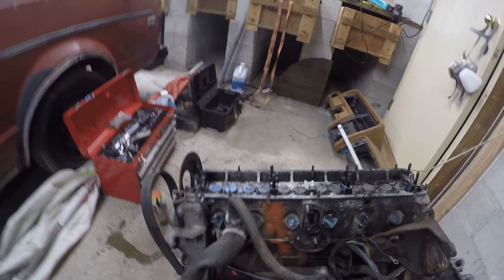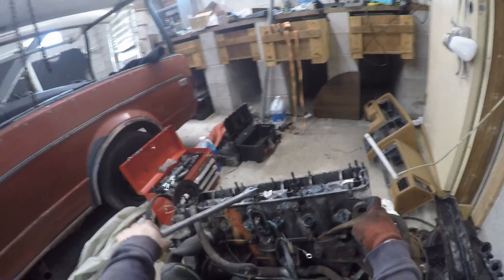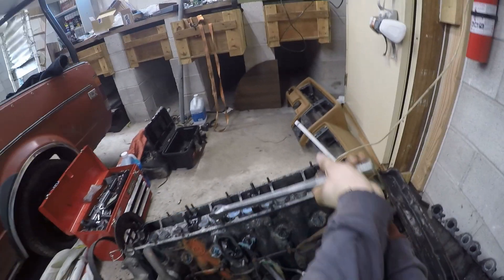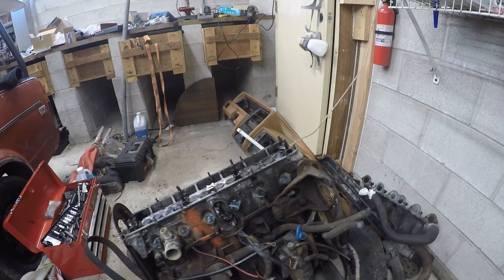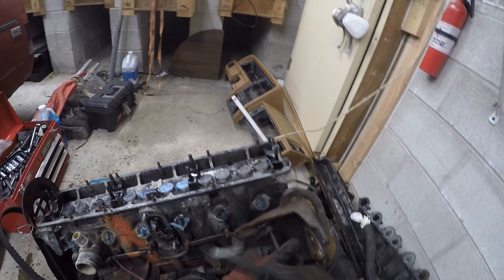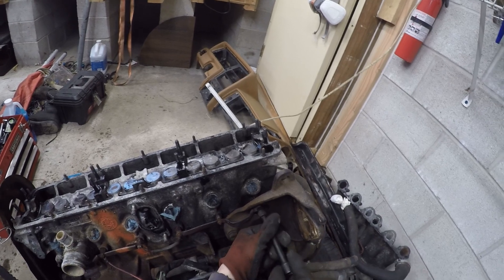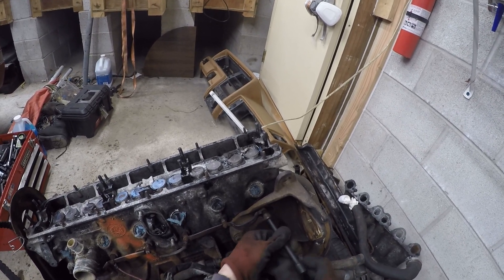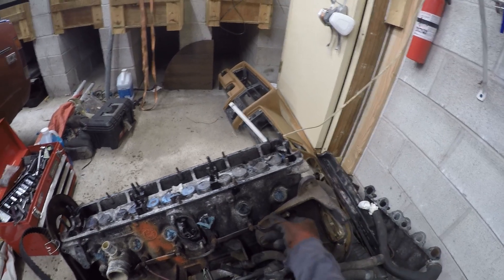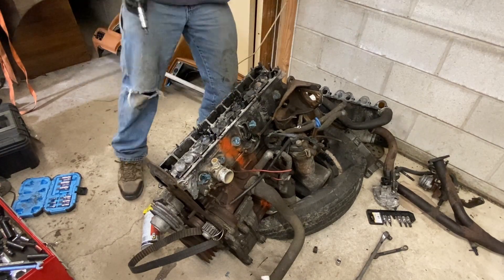Now there are just a couple more things — there are some sensors in the front, a sensor in the back, of course the head bolt I apparently forgot about. Sensors in the front and back are just held on with spade clips. There's a bracket — I already took the bracket off in this clip. And then this glow plug line that's looped around on the block side is an eight millimeter to take it off. To take off the very end, they designed it so you don't actually need to take the nut all the way off — it's a fork-shaped clip. Now that everything's broken loose, time to rip them all out.